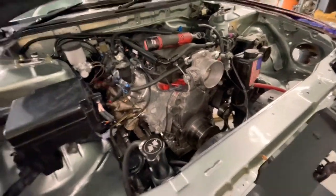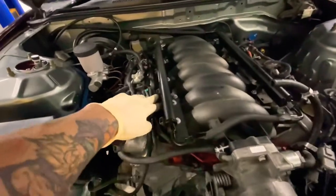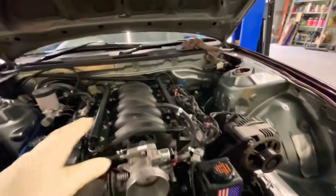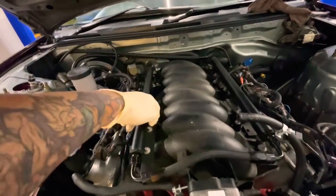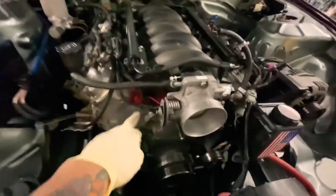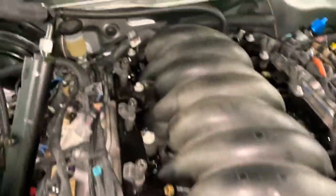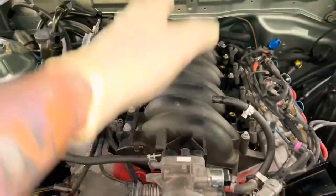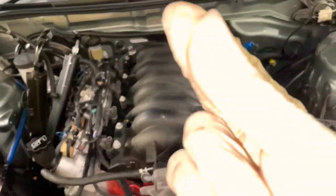For this manifold, I disconnected all of the injectors, the connector in the back, a sensor, all the hoses and connectors from the front, vacuum hoses, and my catch can which is set over there. Now we're just going to remove the bolts holding the manifold, get the manifold up, and then replace the water crossovers. I had to take the fuel rails out — I left the injectors in there — a lot of fuel came out, but I tried to catch most of it. Now time to remove these other bolts and take off the manifold.